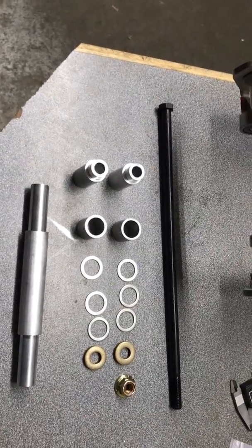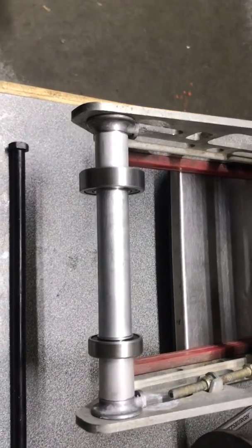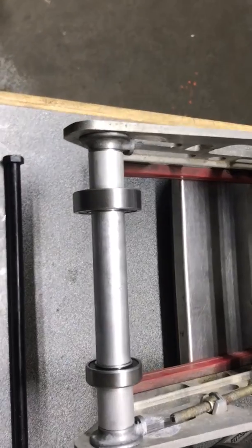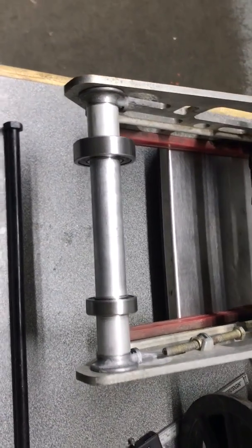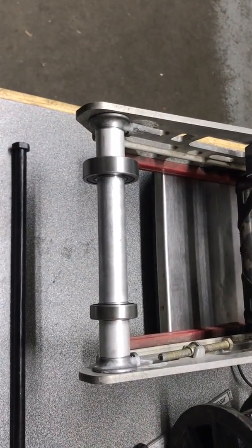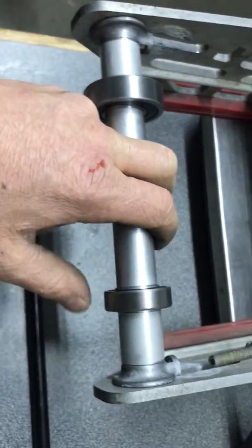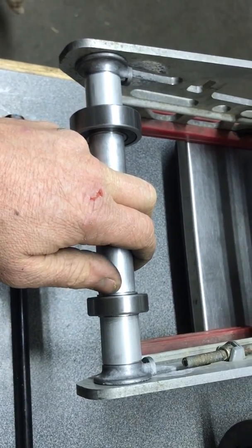The nice thing about this kit is it is designed to accept wheels with a 6004 bearing and also a wider 6304 bearing. The stock tri-hub comes with the 6004 bearing, which is the smaller, skinnier bearing. And if you're going to utilize wheels with a 6004 bearing, you're going to have 2 shim washers on each side of the bearing.